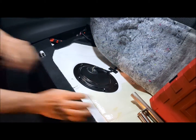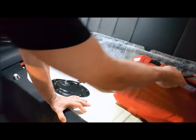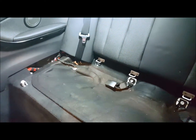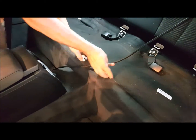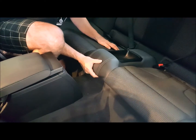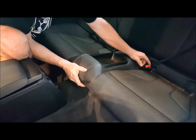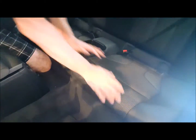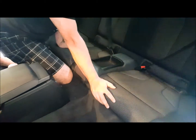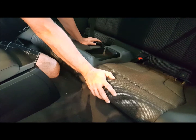Set everything aside and go ahead and lay this in place. Grab our rear seat and slide the rear seat in here. After you slide your seat back in place, you'll notice the seat belts — use the seat belts to pull the female receptacles up through the seat. Make sure it's pushed all the way back, then push down in the center and you can hear it click. And that's it — you've now replaced the LPFP and managed to put everything back together. Thanks for watching. That was the F-Series LPFP replacement from FuelIt.com.